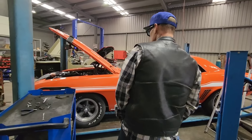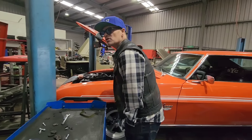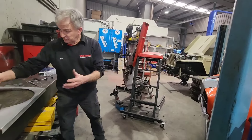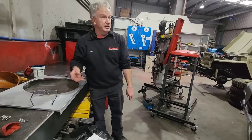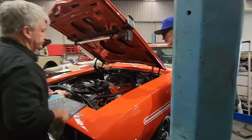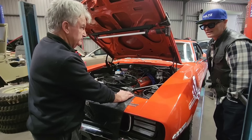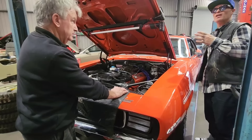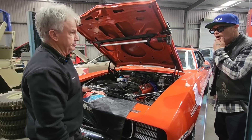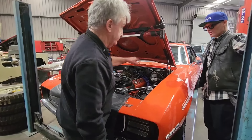I like the wheels on it, I like everything about it. It's got a 427 in it? 427, Turbo 400. So what's your diagnosis with the heating problem? Well, it had that on it, and we reckon that when it's probably just cruising along, there's not enough air blowing through the radiator. So we're going to try it just with the fan. It's running 200 degrees, and from what a lot of people tell me, they run at 200 degrees. Everybody says 190. But 200's not far from 190. If you get it past 220, I guess that's the problem. A guy here that races them said if it was 200, you wouldn't spend too much time trying to get it any lower.